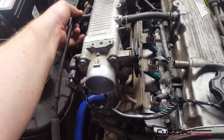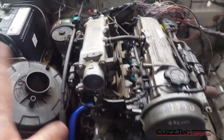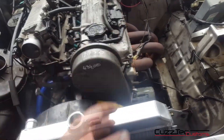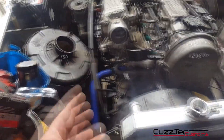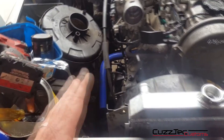What I do is lay out your loom from end to end. I think this furthest end is your coil pack. I tried to strip as much of this wrap off as I can because by now the Barina is about 25 years old and it's all degraded. Then lay out where you want the loom to run — it's not really all that important where it runs as long as it does run.